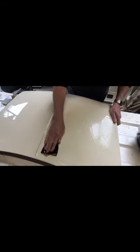So what I'm going to do now is rub it down. Just rub it up and down nice and gently. Most of you guys out there think I should use a block, but I've been taught the old way — donkeys years ago, I'm old school. This is how they used to teach me when I was spraying cars 40-odd years ago. And this is so you can feel the paint — never used electric tools where I used to work, never believed in it, all by hand, everything.